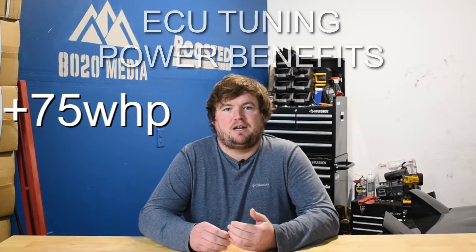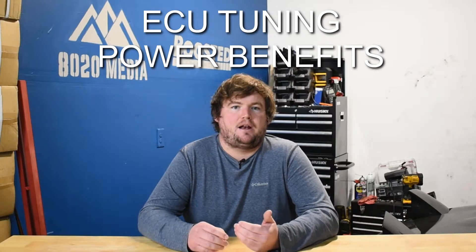Let's dive into the best mods for the N63. Number one on the list, we have N63 tuning. Tuning is really the foundation to building more power. A tune alone — no other modifications — can add about 75 to 100 wheel horsepower and about 100 to 150 wheel torque to the N63. Those are incredible gains up front for just a tune. It's really the foundation because not only does a tune deliver those incredible power gains, but it also helps maximize the power gains from additional mods.